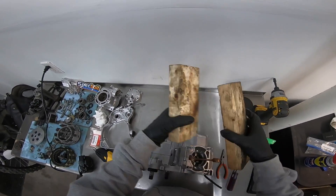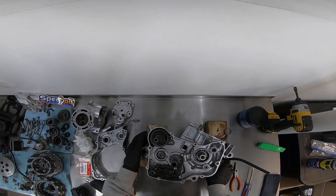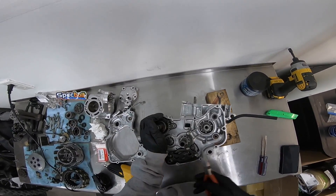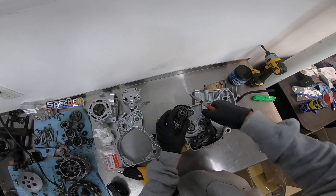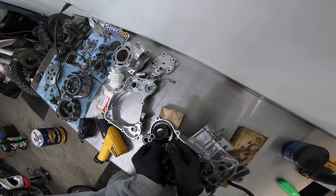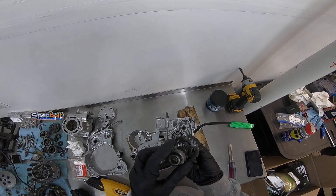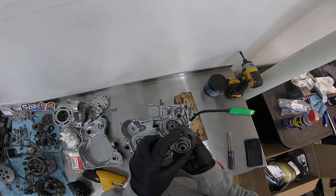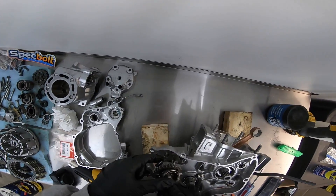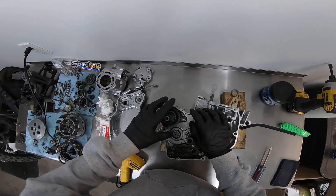What happened was I forgot to put in a little spring on the kickstart gear. I forgot to put this little spring behind there, so we'll just pop this off quick. Good thing I remembered before we got this whole cover on. So let's pop this out quick and put that spring in. There's a little mark on here and a little mark on this other connecting gear, so you've got to make sure they're lined up straight — which they are. I'll take the spring and put it into place like it was before, wrap this spring back around, make sure it's in place.